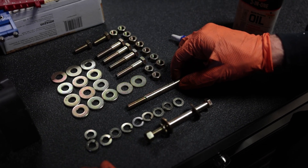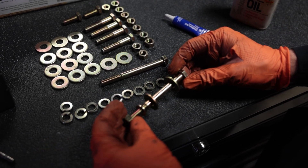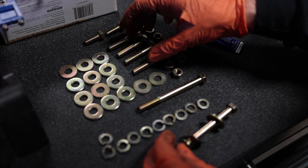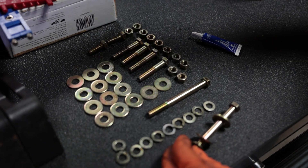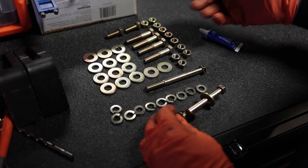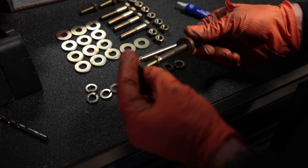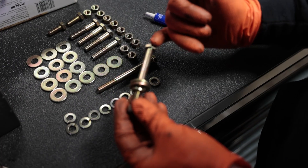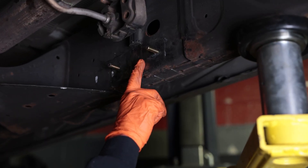There are four long bolts that go through the box frame, medium-sized bolts that connect the support to the cross brace, and really small bolts that connect the center carrier bearing from the driveshaft to the cross brace. You'll also want to add washers and lock washers. You can install the long bolts from the outside of the frame to the inside, or vice versa — going outside to inside looks a little bit cleaner.